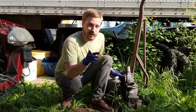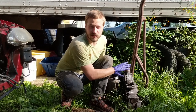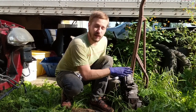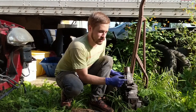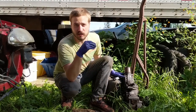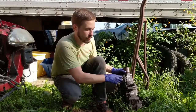Jacob from Rust Belt Garage is filming for me and I'm about to put in the transfer case. I've already filled this with lube through the actual driveshaft hole because it's easier that way. There's some debate about fluid amount, but I went by STM Tune which says it's 0.55 quarts. Basically you should put it in the car, make sure it's filled up to the fill hole, drive it around, then check again to make sure it's still at the fill hole level. I'll slide this in, put the driveshaft on, and use a jack to get it up into position to bolt it in.